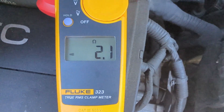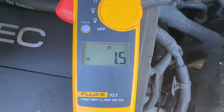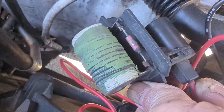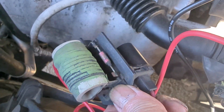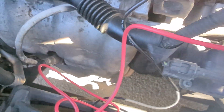To test our new one, you see that it's basically got continuity — that's the way it's supposed to be. This is our new one. And if you look at the old one, you can see the resistor there — it looks like it's all kind of hot and burned up. So it shouldn't really look that way. We definitely got a bad fan motor.